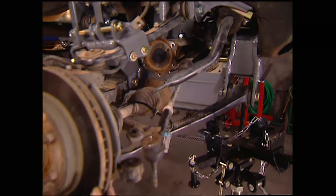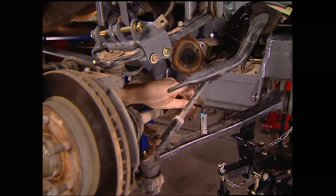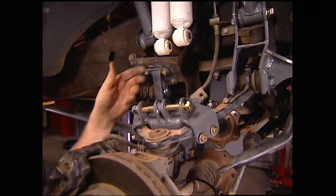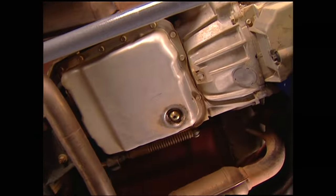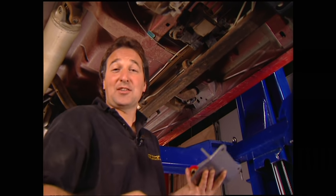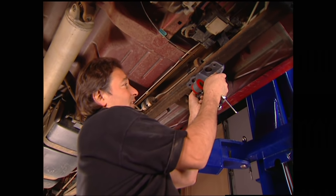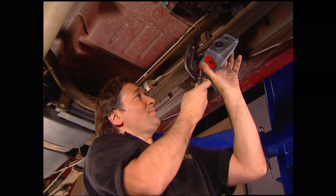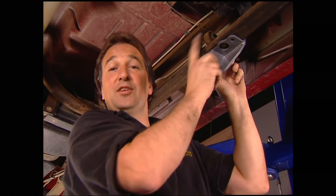From here on out, everything will just kind of fall back together. You've got your tie rod ends, your sway bar end links — don't forget your ABS sensor. You've got your axles. Put your brake calipers on, make sure that you have enough slack in your hoses. Your shocks come down and mount to this bracket that sits right on top of the upper A-arm. Now, you obviously can't drop your A-arm six inches and expect the torsion bars to line up. The kit comes with brackets that mount on the frame and drop your cross member — use the rivets for alignment, clamp it in place, drill your holes, remount your cross member, and reinstall your torsion bars.